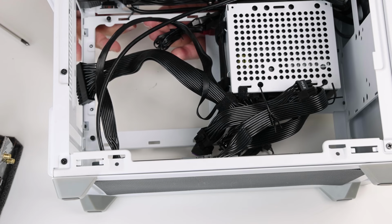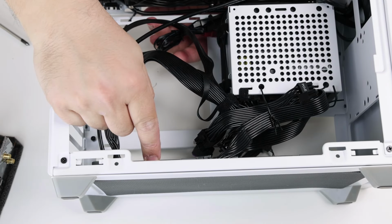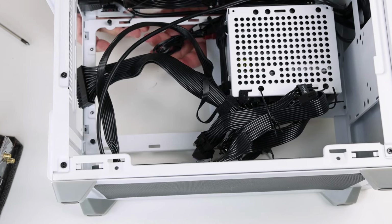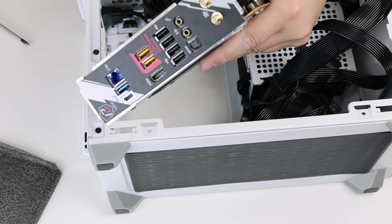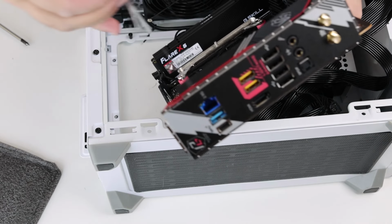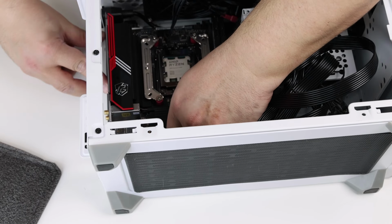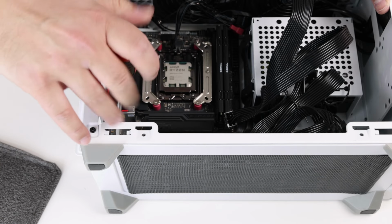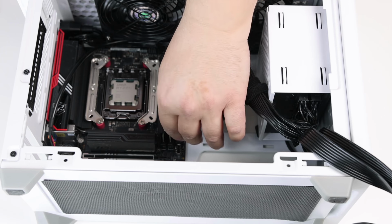With the NR200P, we are not starting from scratch. As you can see, we have already built in this case. You can check on our channel. We have added two slim side fans at the bottom for better cooling of the GPU. Also, the Cooler Master fans coming with the case are at the top. And here is the PSU. We decided to switch the power supply to go at the front, to free up some space in here.